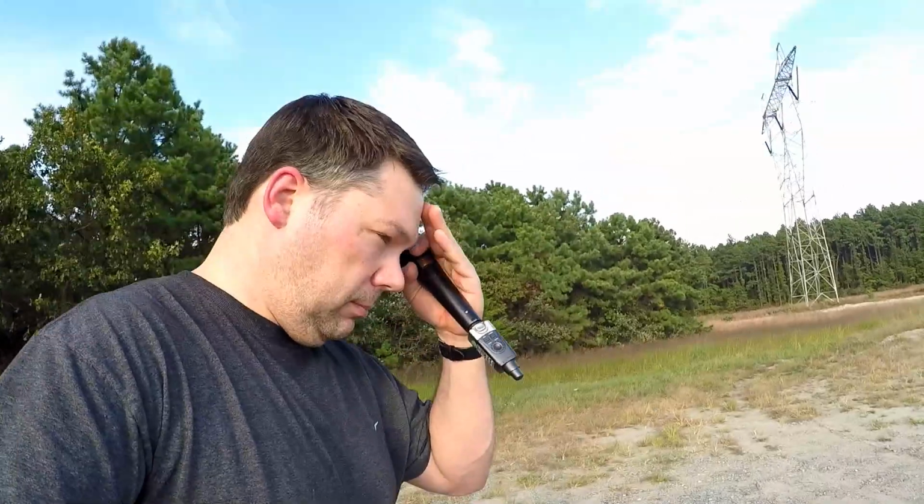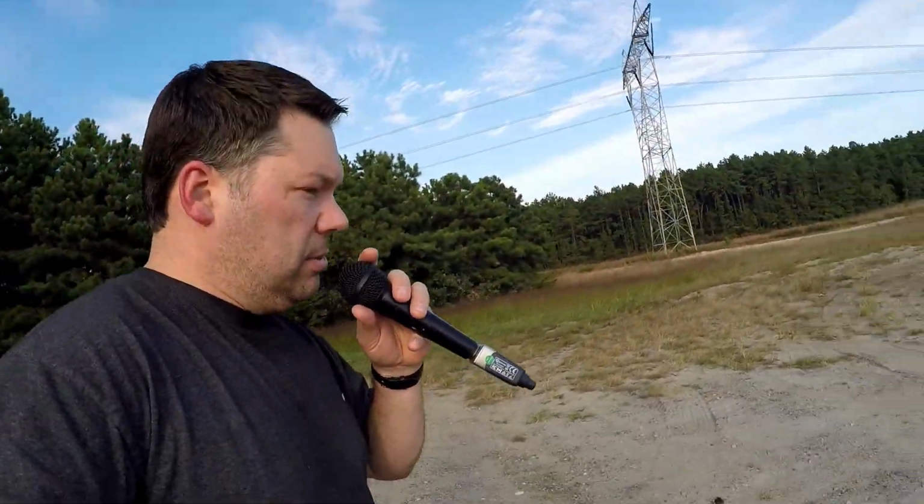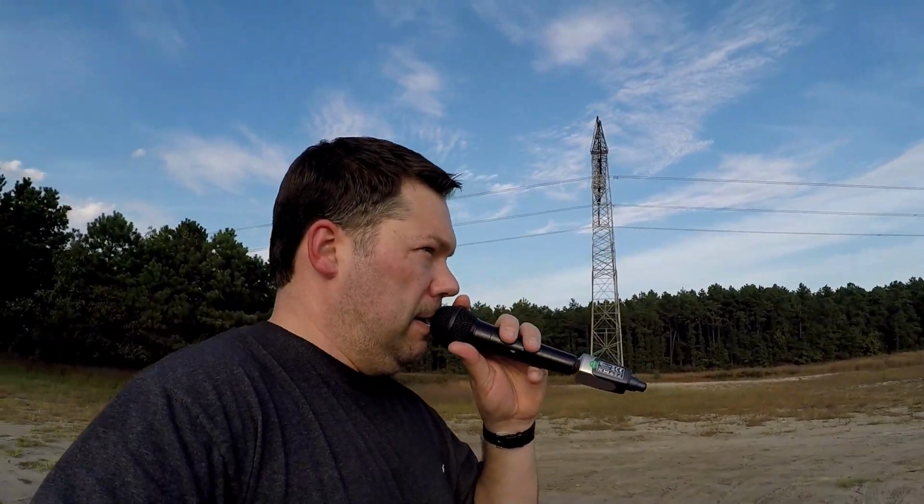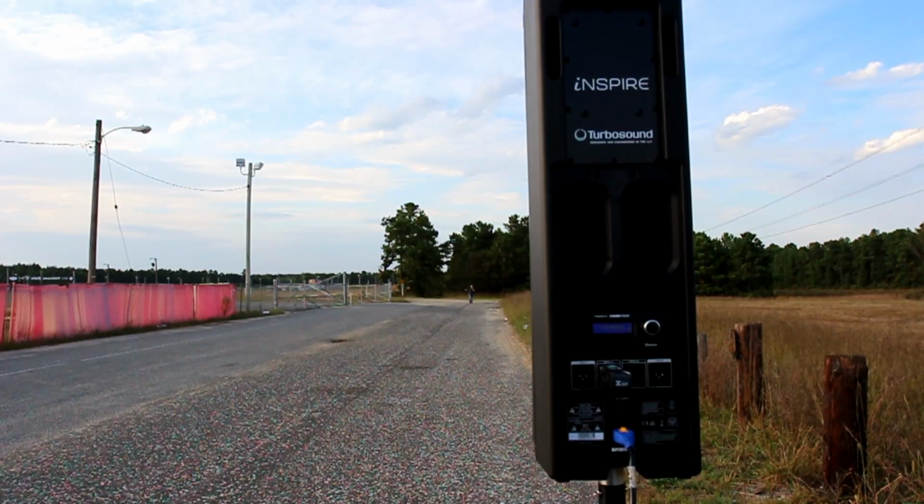So the one thing with these is that a lot of cell phones can cause some problems. Even putting your hand over the end of this will have it cut out, especially on the other side of the receiver. Which is weird. So if I start to do this, you can see that now the signal is all banged up, muffled, wrapped, gone. But then when I go like this, we're back on and we're fine. So I'm getting winded. It's far. Here we go. Going back.